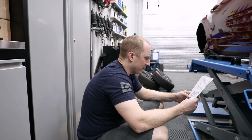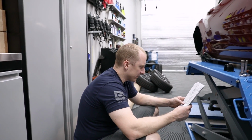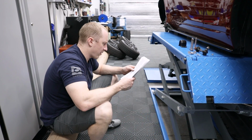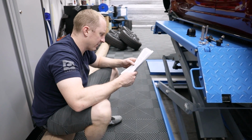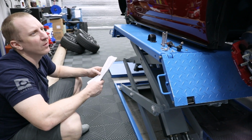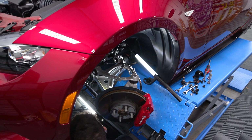The passenger side of the bar will need to move up to clear the portion of the subframe that projects forward. Try to work the bar in front of the tie rod on the passenger side. Turning the steering wheel all the way to the right will help. Move it in front of the left tie rod as well. Well, we're way past tie rods.